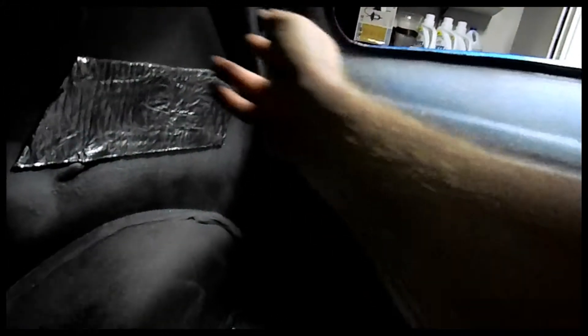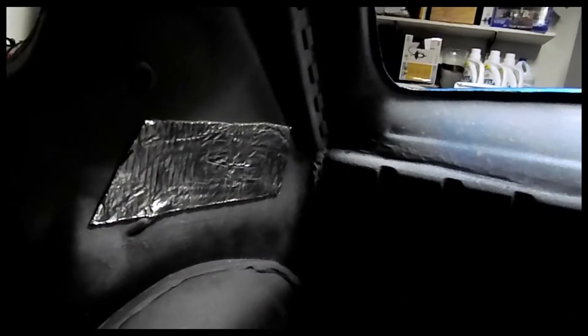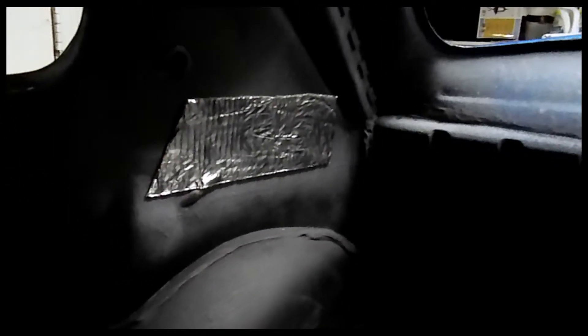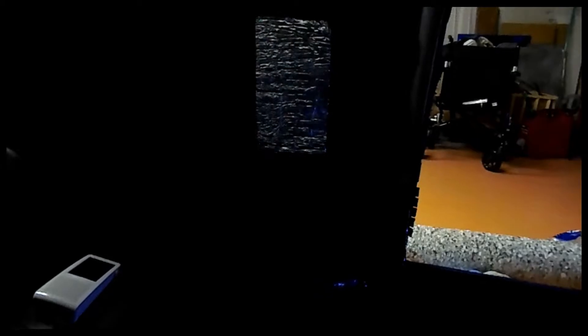I'll cut another little triangular piece for that spot and that will do a good chunk of that area. I've always noticed in Volkswagens it's the back luggage tray area — when you're driving around, especially here in Florida — you always get heat back there because of the exhaust and all that. Another area I've noticed, especially in John's Oval, is that the ovals are much more hollow with no insulation in there, unlike the late models which have foam. Some ovals I've seen have like little pillows stuffed up in there to get the noise down — John's has got none of that. What we notice is the hot air will actually come through the channel, and if he has no door panels, it will come out and actually heat up the seat. So if you've got a car and you're going to run without door panels, that's something to keep in consideration, especially in a hotter weather area.